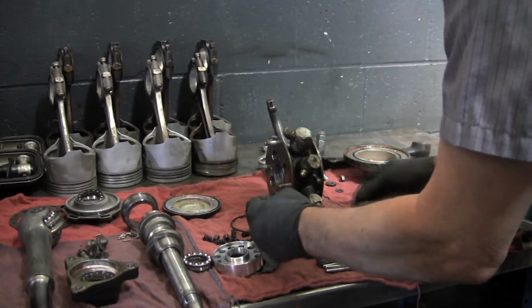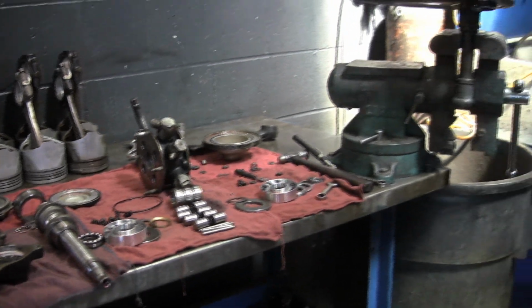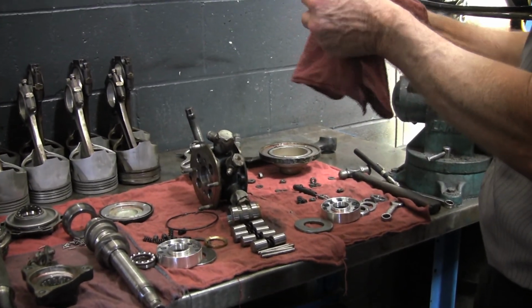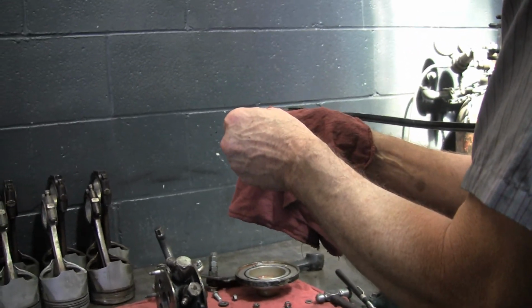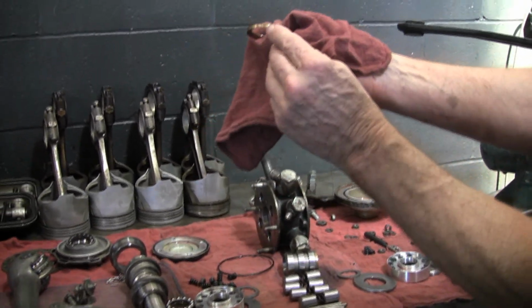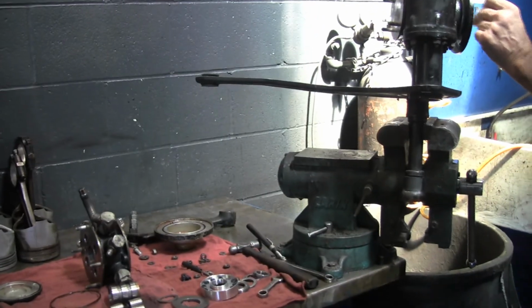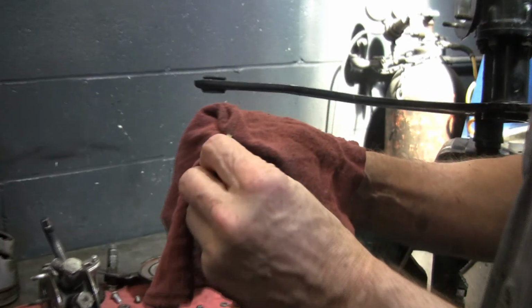Now these washers, if I can get rid of these. These washers are all numbered. Usually the valve is numbered V. So you've got V3 and V4, and you see there's a 3V right there. If you put it back together, you have to remember that the 3 goes towards this end, and the 4, which will be this one, 4V.